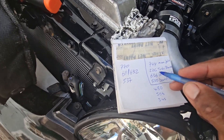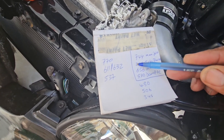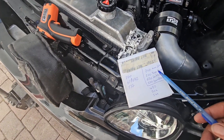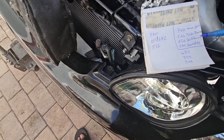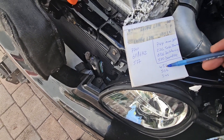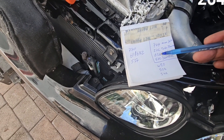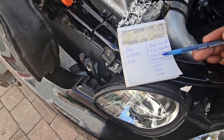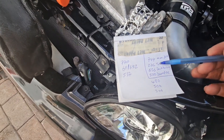The wrap and spray seem to be working. The turbo blanket is super, super good — from the surface of the back housing to the outside of the turbo blanket, that was a 410 degree difference. Wow, that's crazy. Turbo blanket definitely works — you need to get yourself a turbo blanket. Now looking at the post-shutoff numbers compared to the running numbers: the turbo manifold went down about 240 degrees, the back housing went down about 136 degrees, and the downpipe was about 180 degrees difference. Some good information here showing how everything works the way it should.